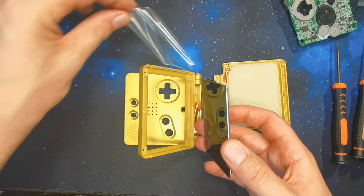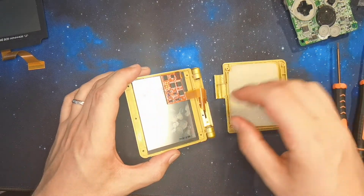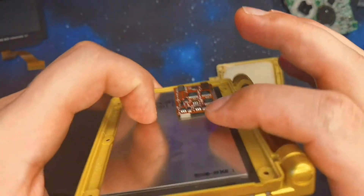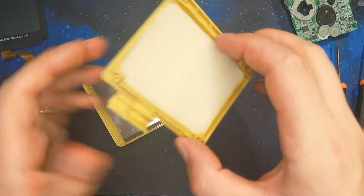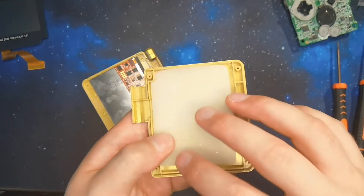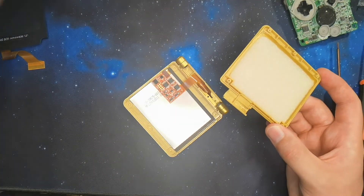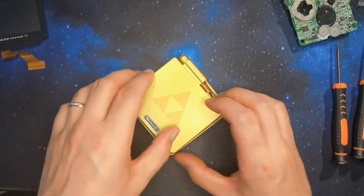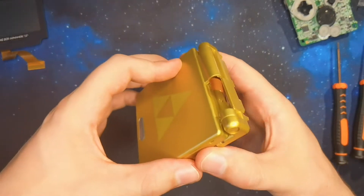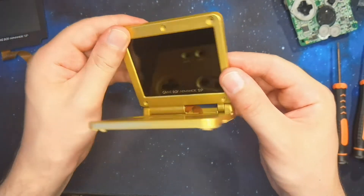I had forgotten — I had to go back in the video. We remove the protective film from the screen. Now here you do the small twist to properly route the ribbon cable. Be careful not to pinch it. Don't forget that we've placed a small double-sided foam to keep the screen from moving around. We've cut with the Dremel — there was a small movement unfortunately. We place the small foam here. We screw the screen back into place, positioning everything well. Be careful with the ribbon cable — pressing gently, not cracking the screen. It fits beautifully. We heard the small clips engage — perfect. Now we'll put the screws back and this step is done.